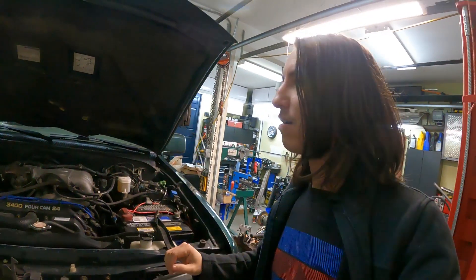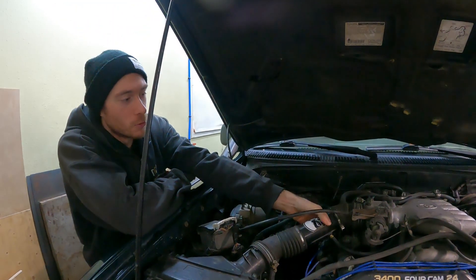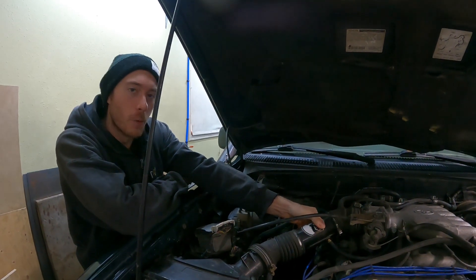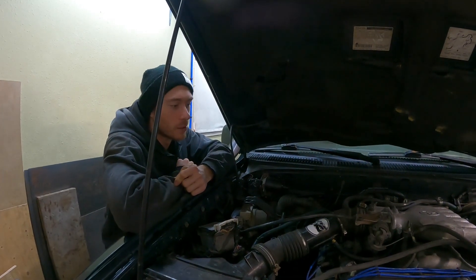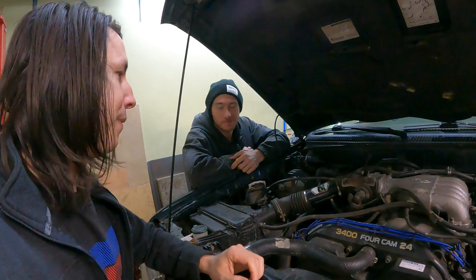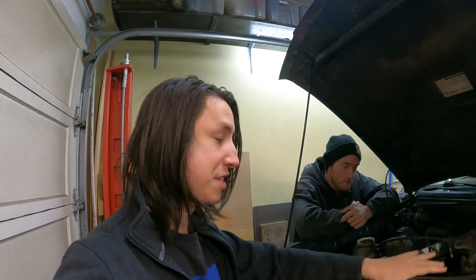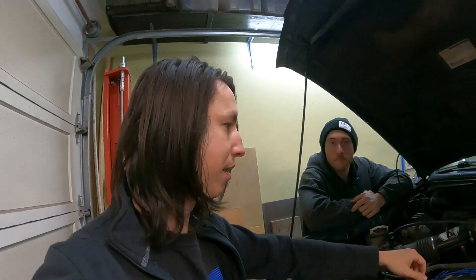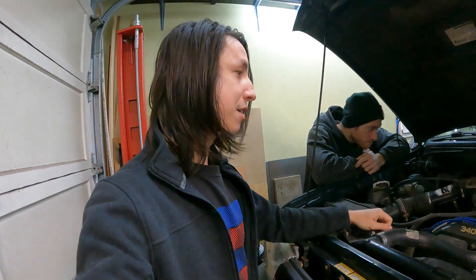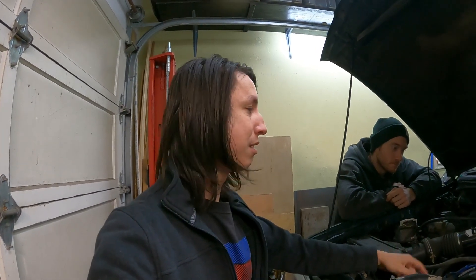How long ago? Probably a year ago — no, like from the spring I think. We saw this piece in the spring and it worked pretty well, but I noticed one thing: it slowly started to warp and it's now oval, it's not rounded anymore. So I asked Cam if he can print this piece from a different material, and he did. The intake piece was printed out of PETG, and the hope was that PETG might be strong enough to handle the temperatures — just the ambient temps in the engine bay — because it's not actually in contact with anything, it's just rubber here. The exhaust manifold is fairly far down. But unfortunately it doesn't look like that's the case, so we're gonna take it out, inspect it, and then throw in a new piece that hopefully will be more durable and handle the temps a bit better.